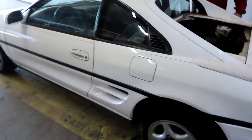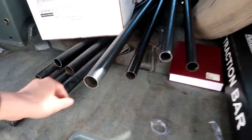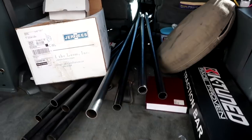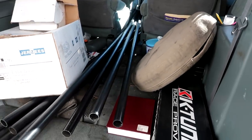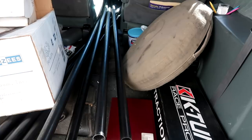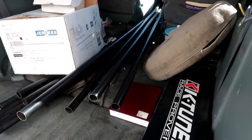This morning we went and picked up some chromoly tubing with Emilio down in Denver. We're going to be doing some roll cage work this week. It's the same size as when we did my hatch — inch and five-eighths chromoly tubing with a 0.083 wall thickness. With this size tubing we'll be able to get the roll cages certified. We're doing roll cages in both the MR2 and the Honda. We have about a hundred feet — just over ten sticks of about eleven feet each.